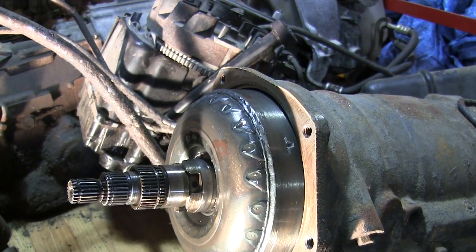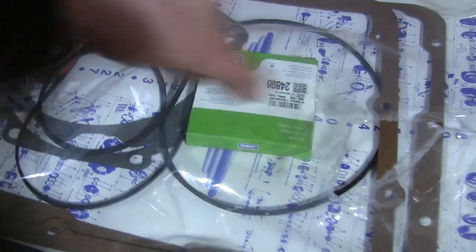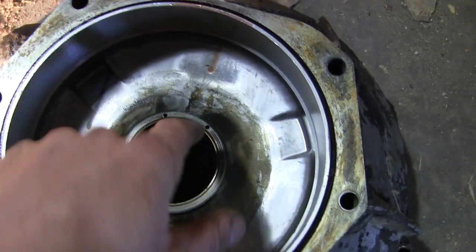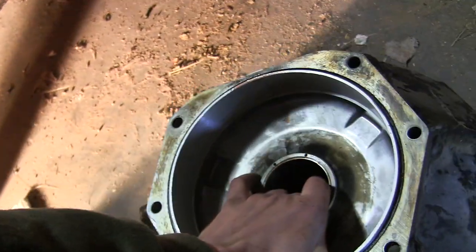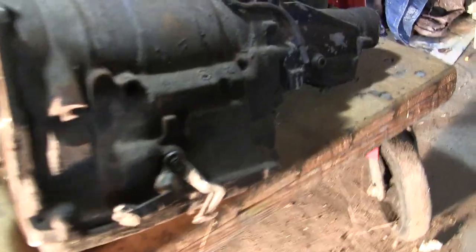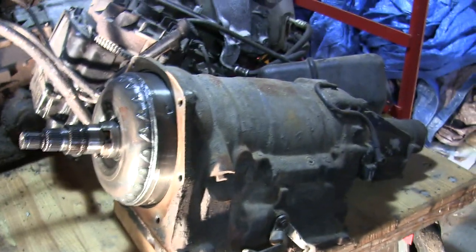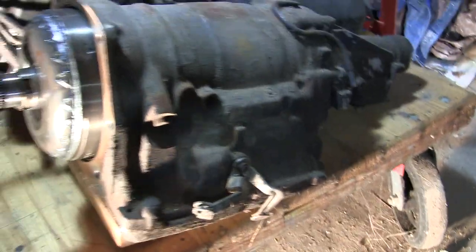I got the bell housing removed and I think this is about as far as I'm going to go into the transmission. I'm guessing my leak was from the big fluid coupling up here — probably this big seal failed because I was dumping a lot of fluid out. I'm going to go ahead and replace that one along with the one on the back, and then the one inside here. There's a couple of holes I can use to punch that out. I'll also replace that rear seal because I kind of dinged that up, and the shift linkage got tweaked a bit. This transmission weighs like 220 pounds, so even the slightest roll can really mess stuff up.